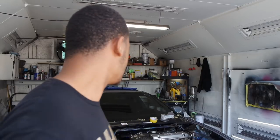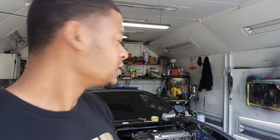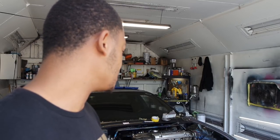Alright, so first thing I like to do is take the hood off and of course drain the fluids, and then get at least the front end up on jack stands. The order in which you go in is kind of a matter of preference. But a quick breakdown before I get started: I'm pretty much gonna want to unhook everything with the harness. In my case, one of the first things I'm gonna do is disassemble the turbo parts, and then take out the axles. The wheels are already off. Take out the axles, disassemble that, and then it's actually pretty simple, man.